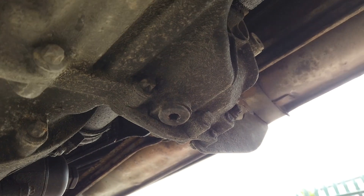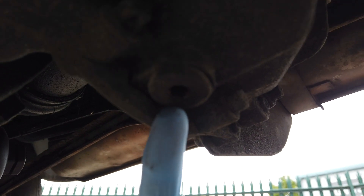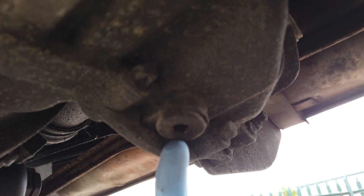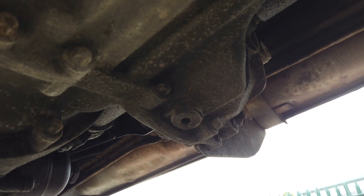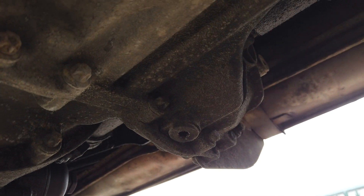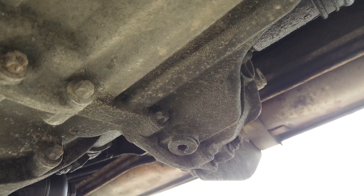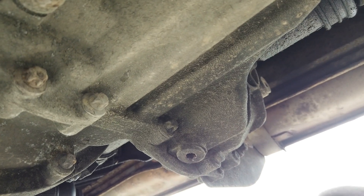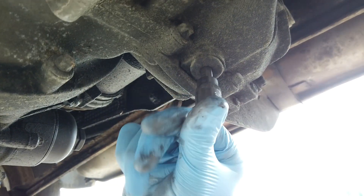So we can point out the drain where we're going to drain from. We reckon it's an eight millimeter socket on that drain plug. Good job you're here Tyler. Let's have a go at loosening it, but you don't want to take it out because it's going to drip on your head. What I suggest Tyler is put that socket in and give it a little tap with the hammer — that'll make sure it's located fully in the plug.